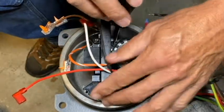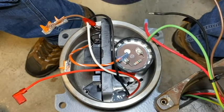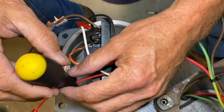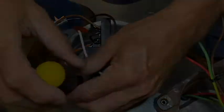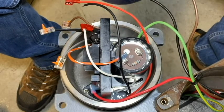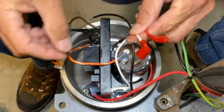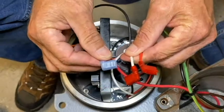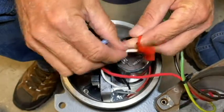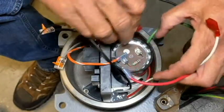Make sure to align the hole for the other screw before tightening the first one completely down. Now that the new motor controller board assembly has been installed and secured, we go ahead and wire it up. It's a relatively simple process — we have three wires with flag terminals: the red pump cable wire, the white motor wire, and the red start winding wire.